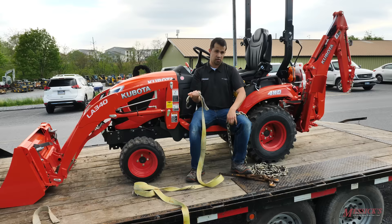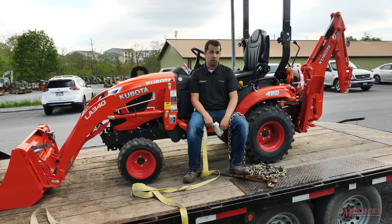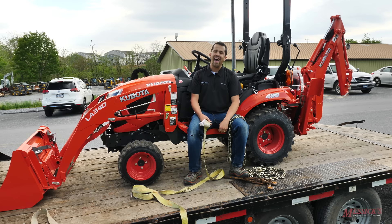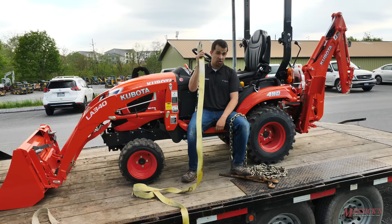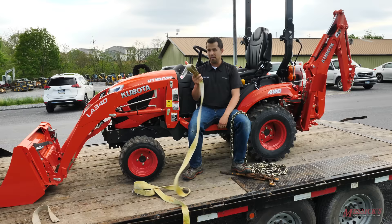Concerns with straps tend to come from one of two things. For one, the breaking strength is lower than chains. If they go across any sharp corner, they can tear and rip. Speaking for our own dealership — one of our sales guys about 10 days ago was hauling an RTV on a small trailer secured with two 3,000-pound straps. He crossed over a train track and the bottom of the trailer struck the rail, which literally ripped the hitch right out of the back of his truck and the trailer stopped cold. The RTV did not stay on — it was secured with two straps well within their load rating and properly applied, but they ripped off and the machine came off the trailer at probably about 15 miles an hour.